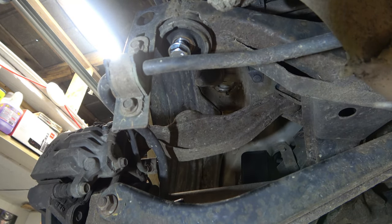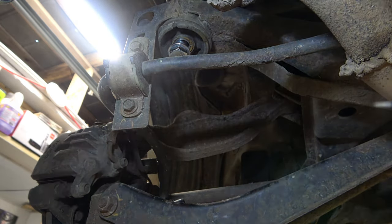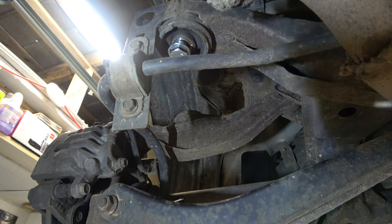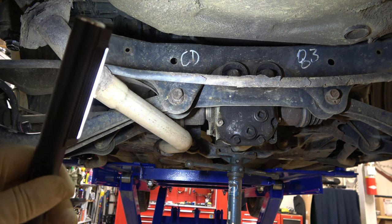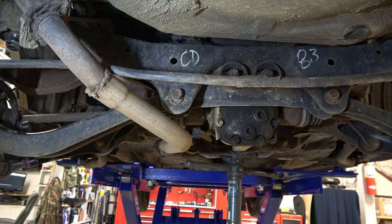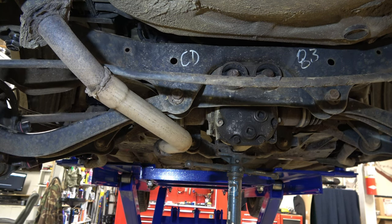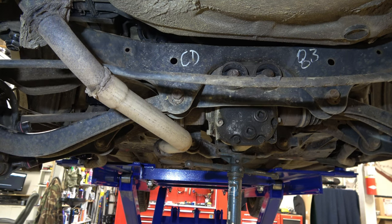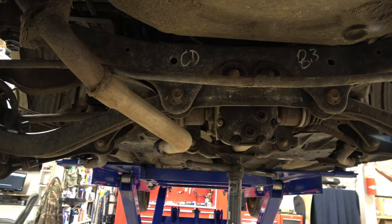I wanted to make sure I was right about my intuition before I filmed it, so I did go ahead and do the driver side. You can see the block back there. The spacers for the trailing arms are also installed. The manual says to support the pumpkin right there, then take all these bolts out — everyone on both sides. That sounded like a really bad idea to me. So what I did is what I do when I'm working on front cradle work — I'm not taking all the bolts out at once. I'm going to loosen the bolts and drop them down so that I have access. I'll differ with Anderson Design on this one.